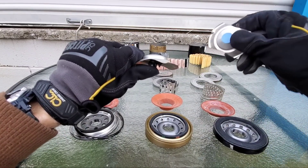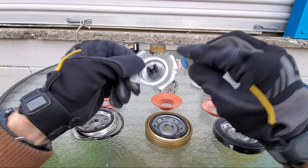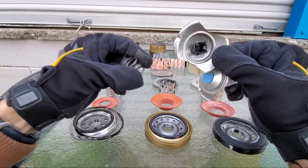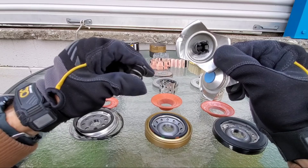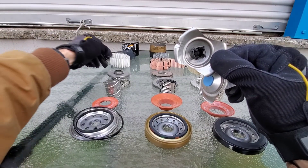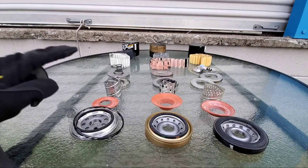The Mobile One and Fram definitely make a poor quality stamped steel bypass spring. Yeah, it does work, but it's definitely not as good as a coil spring like this one — it maintains constant pressure. You want that oil released at a specified time, quickly and accurately, when the engine is very cold or you have an oil blockage problem, which you shouldn't have if you change your oil on time. But it's the cold temperatures that you really have to worry about.